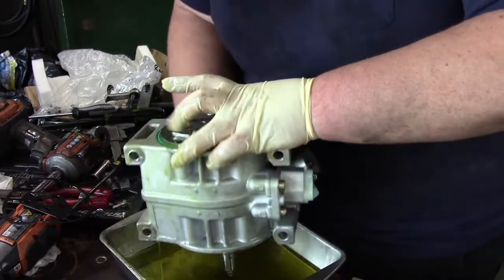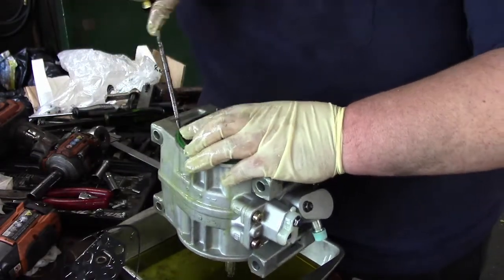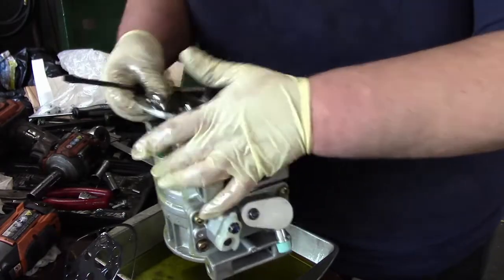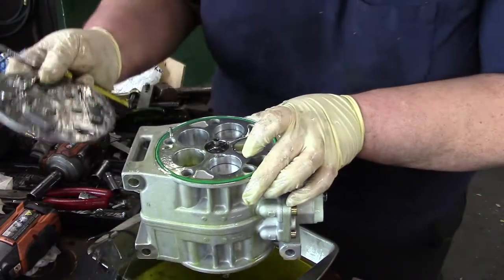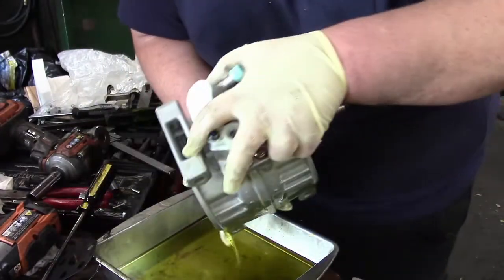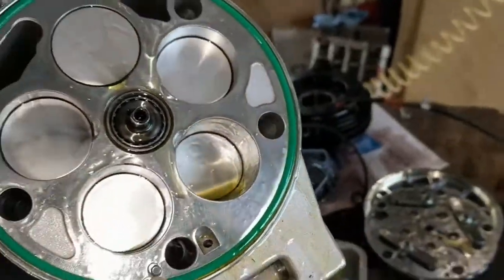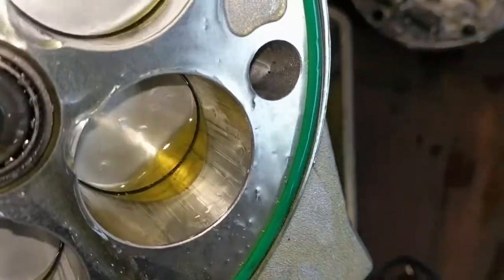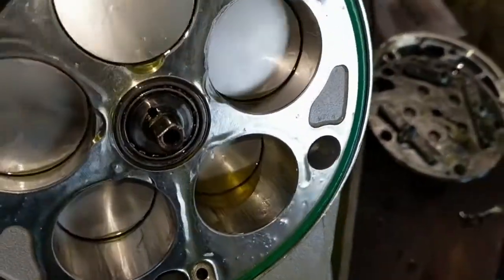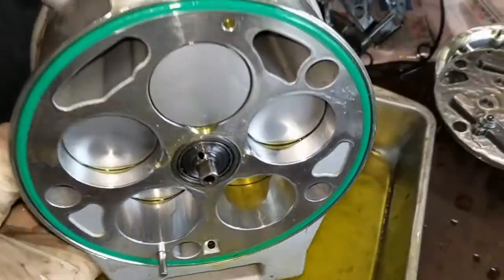Let's flip this back up, take the valve plate off. And I see our failure. Looking down into the bores of this back housing, we see scuffing. This style of compressor is unique in that there are no piston rings — we have a very, very tight cylinder-to-wall clearance. A little bit of oil trapped between the piston and cylinder wall provides the sealing. It looks like a thermal expansion issue caused this compressor to scuff.